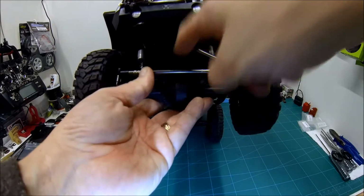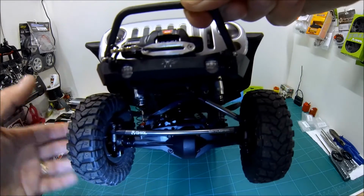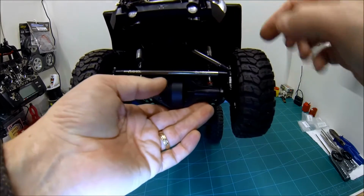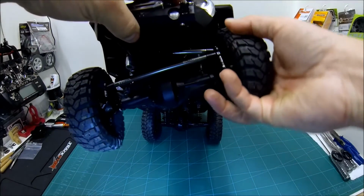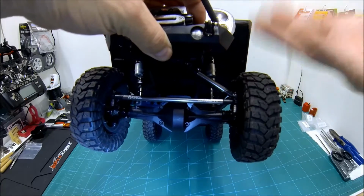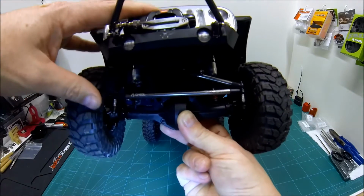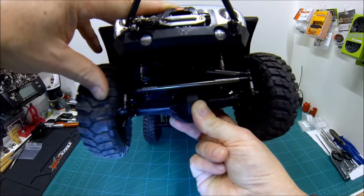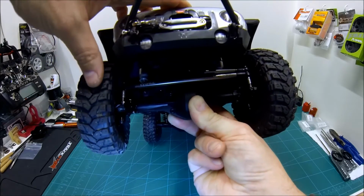You have to have a Panhard bar here, or Panhard rod as some people call it, with a chassis mounted servo. The problem is this drag link, because the servo is not sat on the axle. As your suspension compresses and extends, effectively this needs to change length, but it can't because it's a fixed length. So you end up setting your model up with a sweet spot. For mine it's about there, so everything's great there and I don't get any bump steer, no torque twist. But if the suspension squashes up, it does kick over slightly to the left.